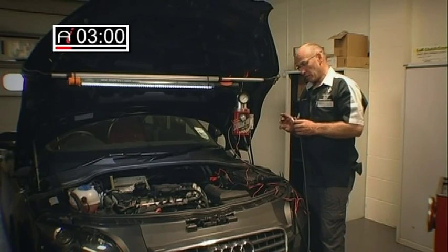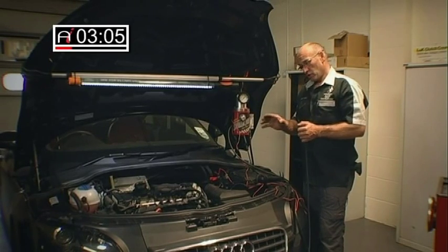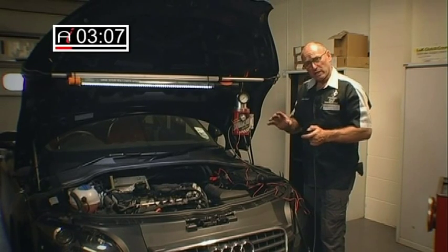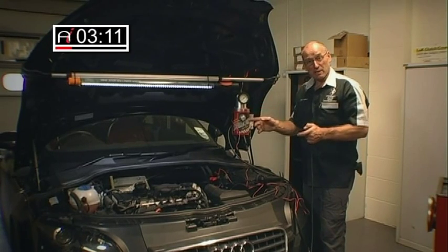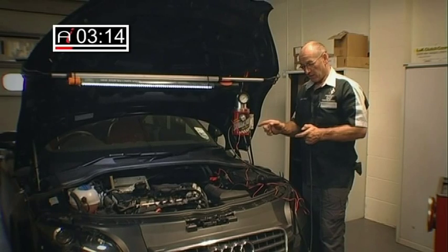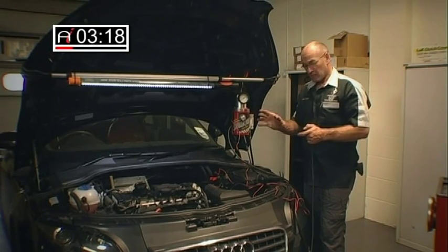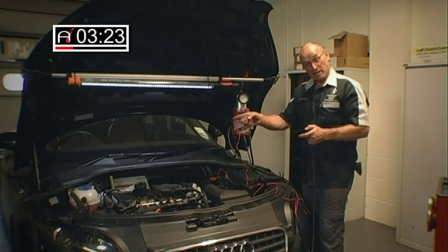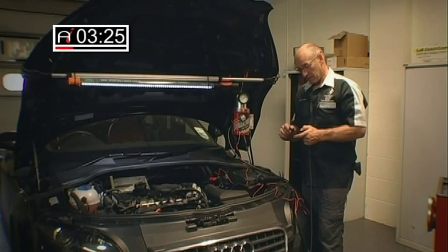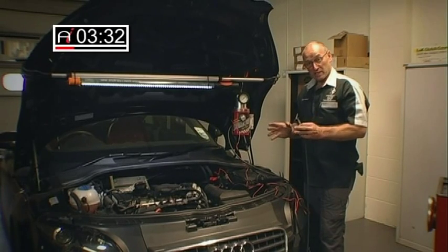Given the fact that when you fill a cavity — in our case the entire intake system — you may hear a squeal or a noise in the background. The ignition is on, the APP sensor, accelerator pedal position, is depressed, therefore the throttle is being driven and is wide open, because I want to smoke this engine from the earliest opportunity of air intake, right after the air cleaner assembly, right through the entire induction system, including the turbo and the intercooler. That's the circuit I'm testing.